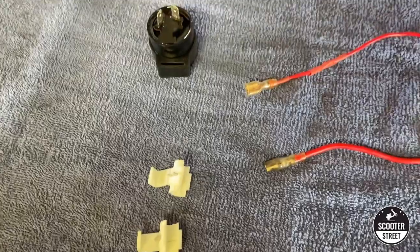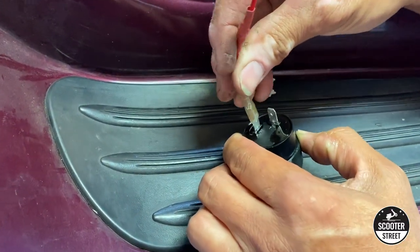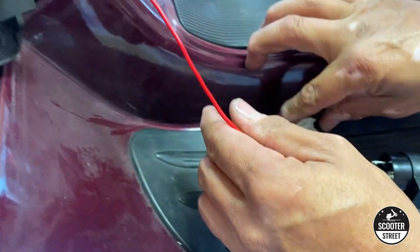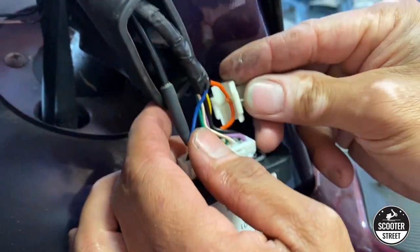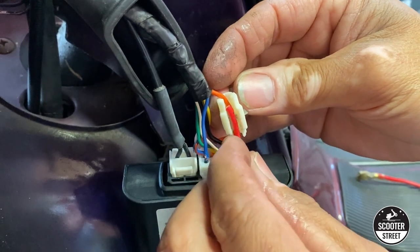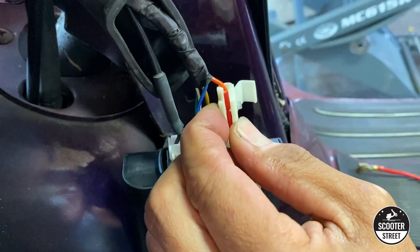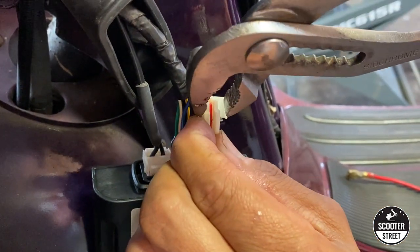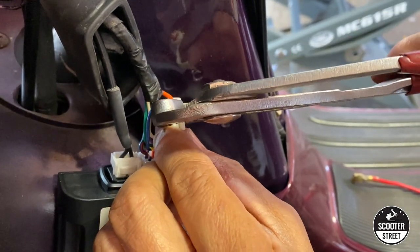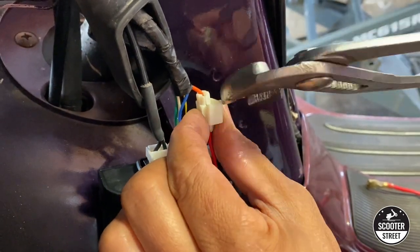When we assemble, we'll use the red wire to the battery terminal on the relay. Once we've got that, we're going to join it onto the orange wire, which is our power wire. Using the tap terminal, both wires go in, and just grab some sort of crimping device and you'll be able to pierce them — just like that. Once they're pierced they're basically locked together.